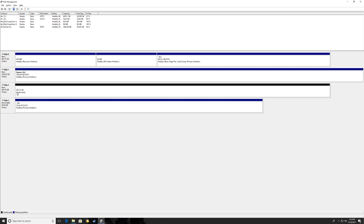We're left with 465.76 gigabytes. If you're wondering why it shows less than 500, it's because drive manufacturers consider a gigabyte as 1000 megabytes, while the rest of the computing world — including Windows — sees 1024 megabytes as a gigabyte. That slight difference results in this discrepancy. It's the same for any drive, and the larger the drive the more it appears you're missing, but trust me it's all fine. The 465.76 gigabytes is unallocated, meaning it's ready for use.